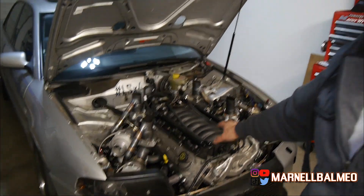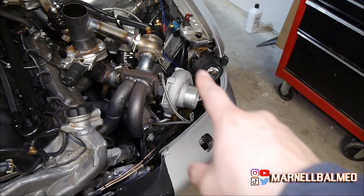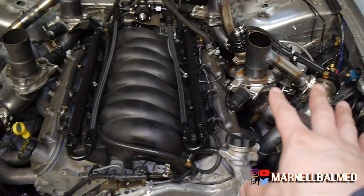Everything is back together. I think I'm down to two possible causes: it could be the positive crankcase ventilation system — though I only have a breather — or it could be the oil drain from the turbo. I'm pretty confident about the turbo angle, so I think that's fine. I'll tackle the PCV tomorrow or in a couple of days. Thanks for watching and I'll see you guys next time.